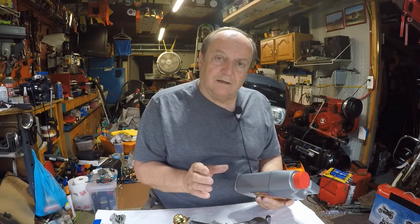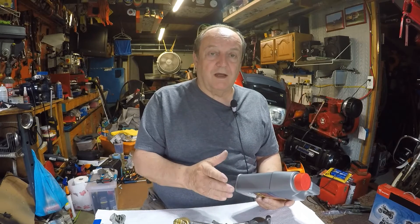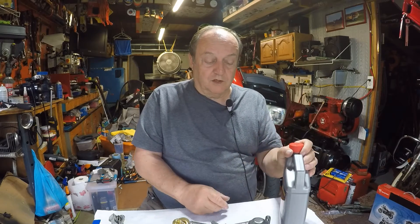I was thinking maybe I don't need all the side panels on — I could just put the seat on and ride it around a loop here maybe four or five times to get it up to temperature. The bottle says to open the radiator cap carefully with a big rag once it's up to temperature. I don't like draining fluid out while it's hot — that engine will build up heat with no coolant, then you pour cold water in. I'm not comfortable with that.